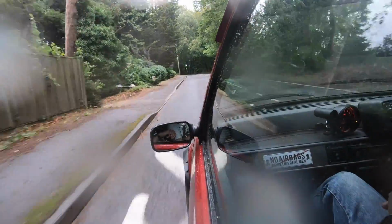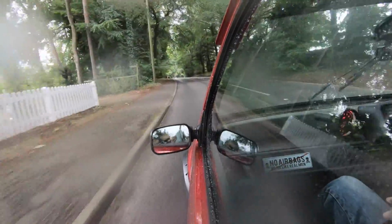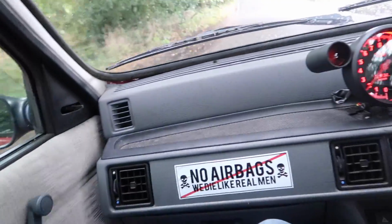So if someone were looking to buy a Rover 100, what advice would you have for them? Are there any faults you should look out for? Are they prone to rust, like an MX-5? Rust is the big one. A lot of the jacking points rust underneath. And obviously, unless you look underneath it, you never know, so that's always a good point to have a look. And the rear arches go quite often on the inside as well as the outside.